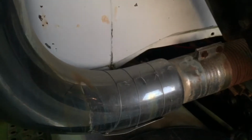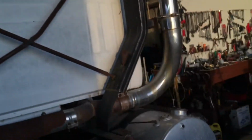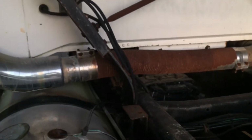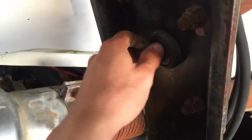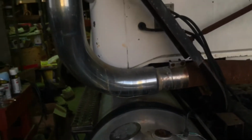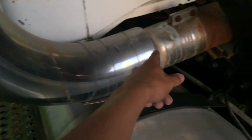They're straight piped. But down here, there's holes because during the rain, nobody would ever put buckets, so the water would be sitting right there and rusted it out. So is that flex pipe. It's not looking best. And neither of these. This side's alright-ish, but it's all rusty. That side is bad. I would like to replace these, at least these elbows, really. Because this up here is alright. Just replace this part.